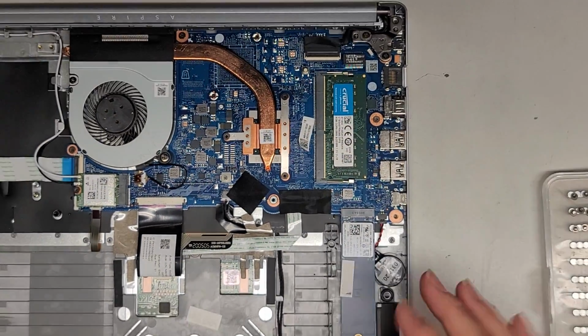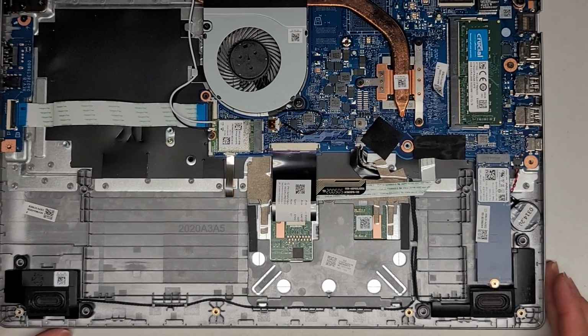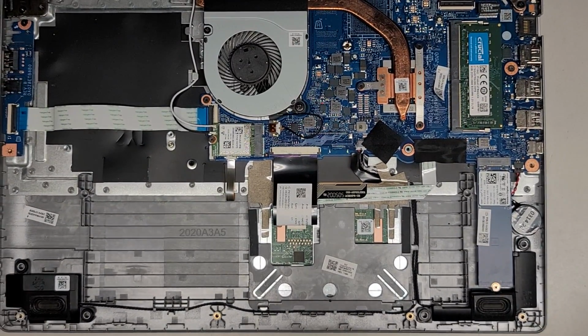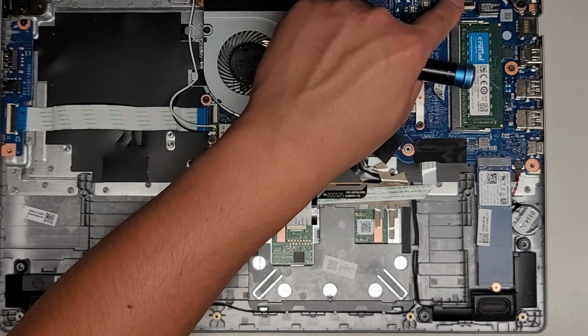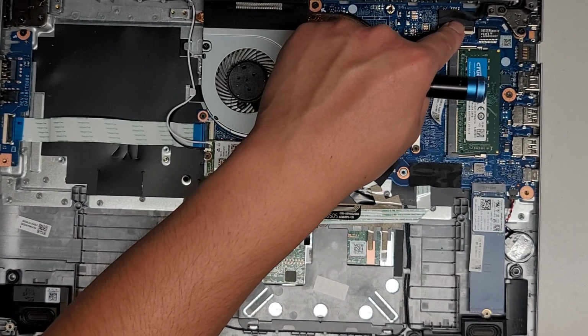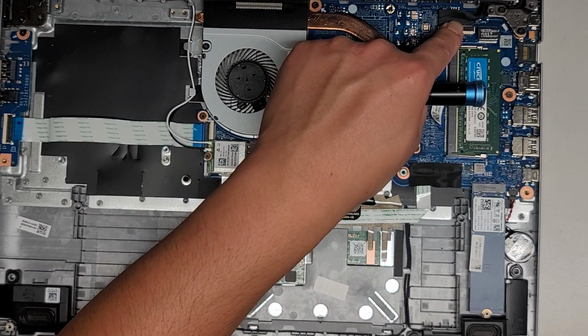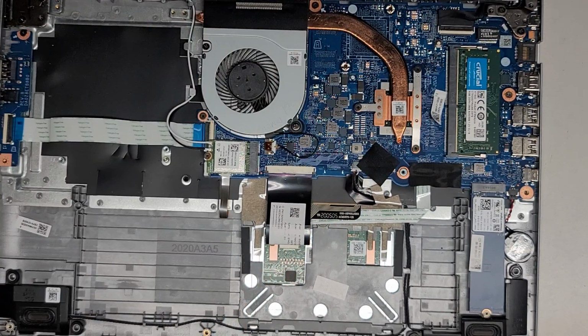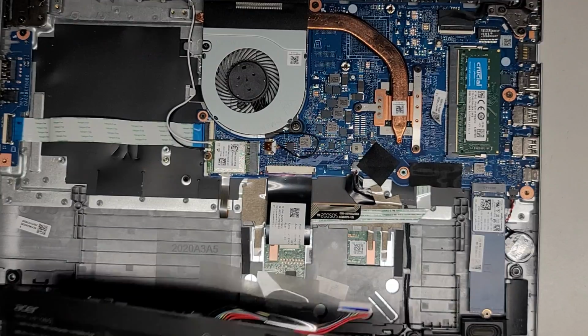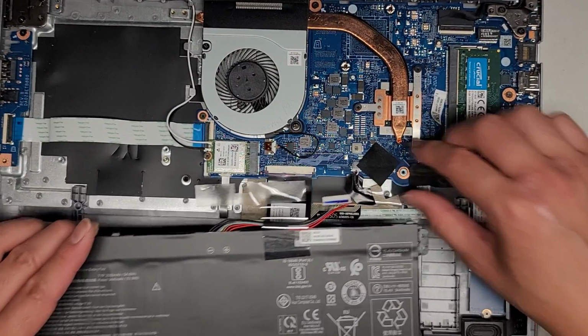Okay, let's zoom out here. I think we're just about done. We have the battery, and I think that's it. You want to double check all the connections, especially the LCD LVDS. If you plug in the battery before plugging this in, you want to disconnect the battery, open the laptop, press and hold the power button again for at least 15 seconds. If you don't, again, you run a big risk of damaging your computer, so don't play games like that. Play it safe and do it right.